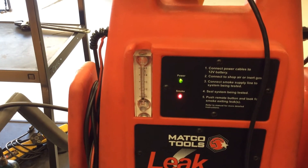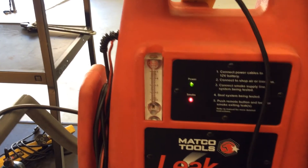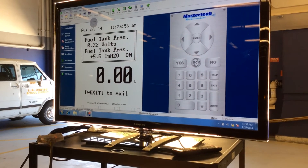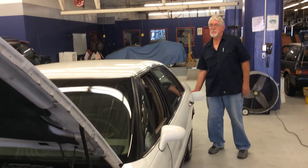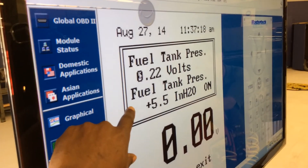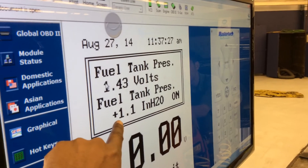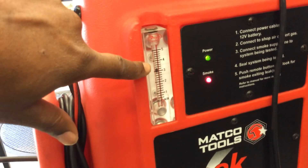So the next thing we're going to do is crack the gas cap — make a leak and watch the changes. We're going to make a leak in the EVAP system and watch the readings. The pressure is going to change and drop right back down to zero. Look at the top one: 1.4 volts already. Look at the bottom one — inches of water right back down to zero. Now watch the smoke machine: the ball is going to start going to the top. Look at the ball indicator — it's starting to flow to the top, indicating we have a leak.